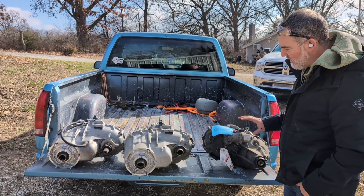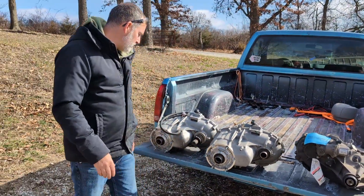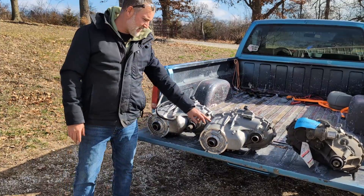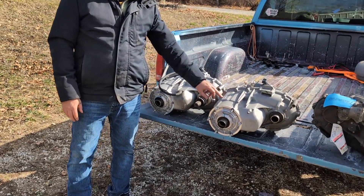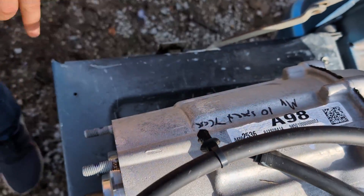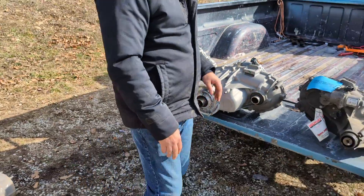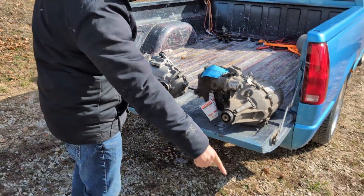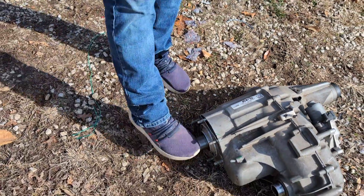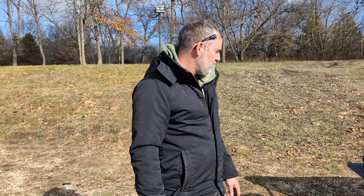I just want to go over the year ranges and the transmission type so that when you're mix-matching, you know what to look for, or else you're going to have a headache. There are some codes on here — this one has an AZB. I'm not sure if all 8-speeds have this AZB. This 10-speed is an A98. That other one is an 8-speed as well and that's an APS. They're always making changes, so you probably can't really go off that tag too well. Just go off the input gear on these.